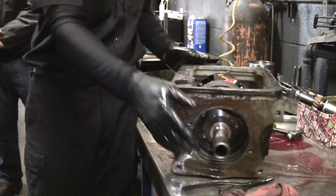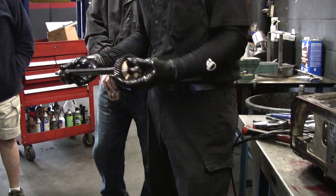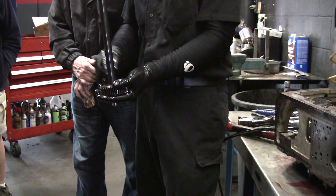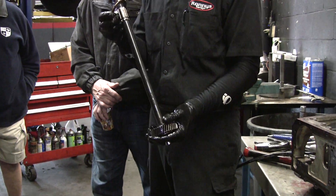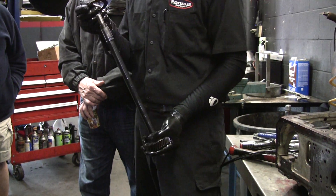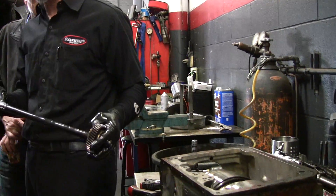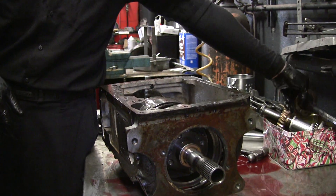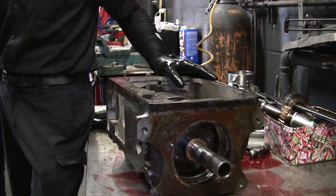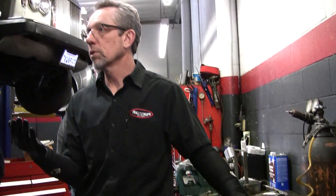A little shortcut there, Ronnie? Here are the two bushings that hold that into place. You'll see a lot of the scuffing on it — don't worry about it, they're all like that. I use Scotch-Brite to polish them up. If it's super thin and you find a lot of golden shavings in the pan, then you need to start looking for problems. See how it's a little burnished — like synchros in a standard transmission. You can look at the synchro and think it looks perfect, but they don't really show wear unless they're super worn.